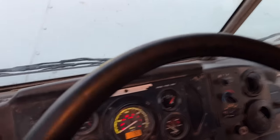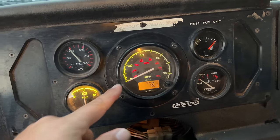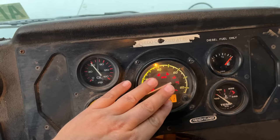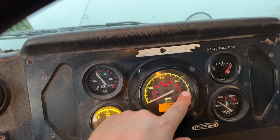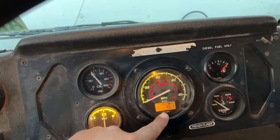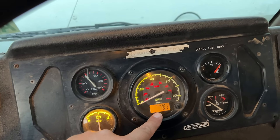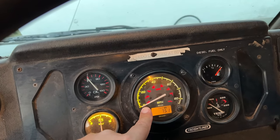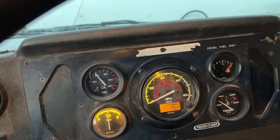Hey, you know what's crazy? Before those batteries were replaced, if you're driving it, the speedometer was accurate. But sitting at an idle, this would run 70 miles an hour when you weren't moving. And the odometer says 75 miles. I've driven it like 8. This is seriously inaccurate, but now that you replaced the batteries, this is sitting at 0. Not moving. This would normally be sitting at 70 miles an hour, idling, racking up miles that it wasn't even driving.